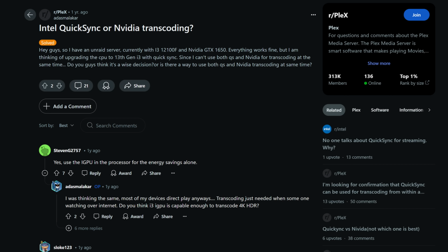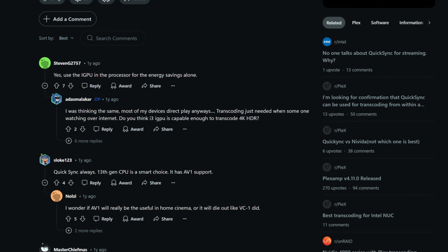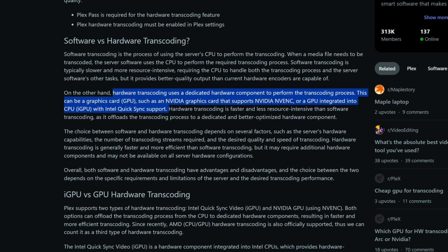The next thing I wanted to do was to make use of the integrated GPU on the 8700. Intel has famously capable iGPUs when it comes to transcoding, which is what we'll be doing. The most common use case for having hardware transcoding is for a media server like Plex or Jellyfin. This allows your media to be transcoded into a different format in real time for different devices without having to stress the CPU at all.